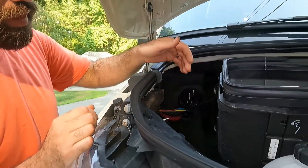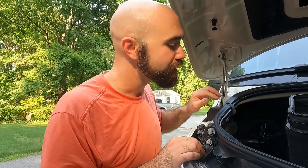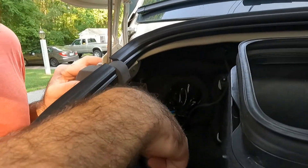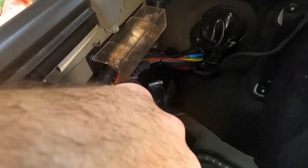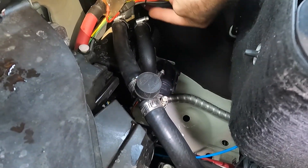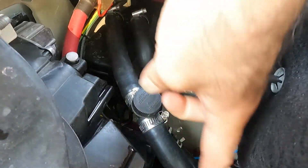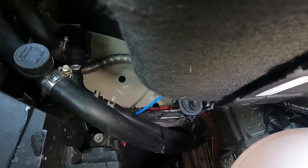This is a S3D5E made by Eberspacher. This unit burns diesel fuel that comes in on that blue hose, and it heats coolant that's inside these lines. It's just a little water pump — a circulator — so we've got hot coolant going through these hoses. Those go downstairs on the other side from the fuel line, and we'll show you where those go.